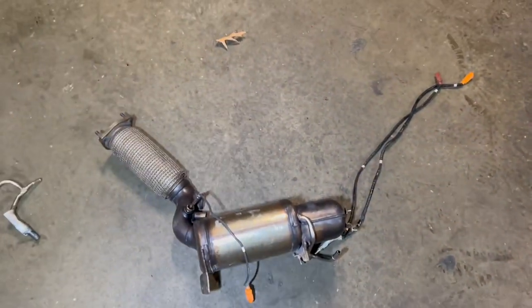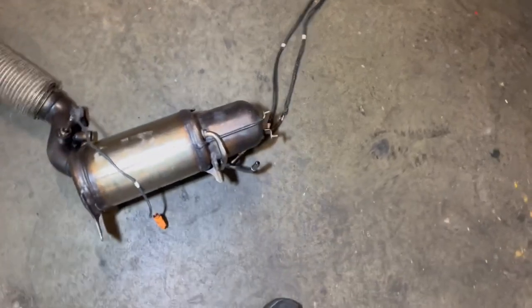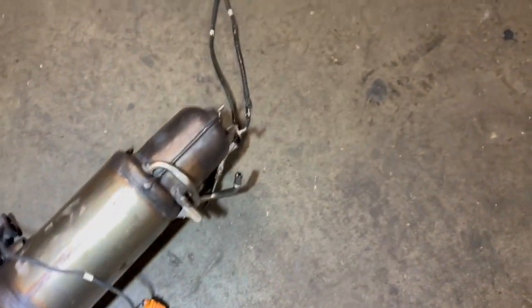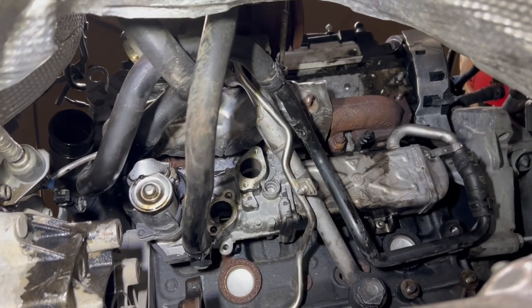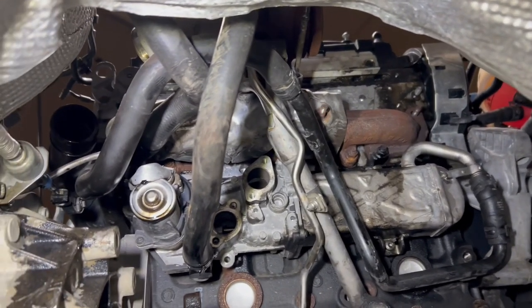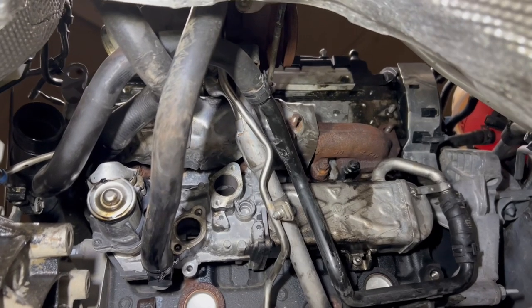Well guys, that might seem like a short period of time but I've been over here for about two hours and finally got this thing out. Key thing: it would go much easier if that EGT sensor was out — it got stuck, so we're going to have to fight with that. You've got to get all the hoses off. Now that it's out of the way you can see where everything is. We might be able to do it without taking the EGR cooler off, but it might be better to just go ahead and take all that off.